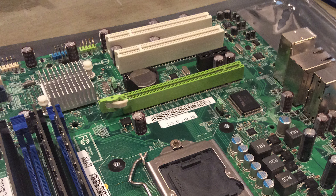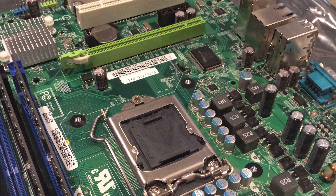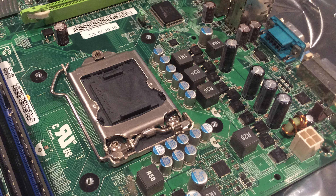So at this point, no matter where you stand, you still have two options. As for Intel, you have the Z370 and Z390, and for most AMD builders you have the B350 and B450, and for higher end AMD builders you have the X370 and X470. In all of these cases, I would recommend that you go with the older model because the newer model will not give you any more performance and will just cost you more money.